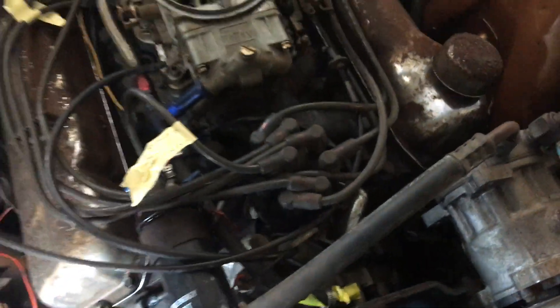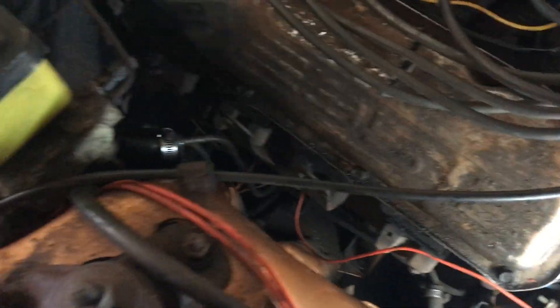Disconnect the coil - make sure you know what wires go where, you can go silly. Since I'm going to pull this engine out, I'll label all the plugs just to make sure I get the dizzy and all that right. But you don't have to do that as long as you know where the plugs go. Pull all the plugs out - pretty straightforward.